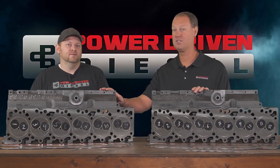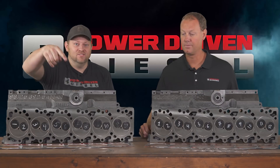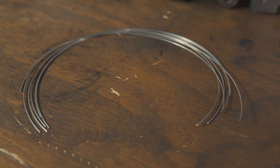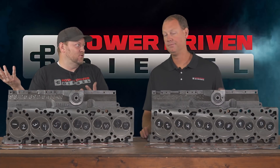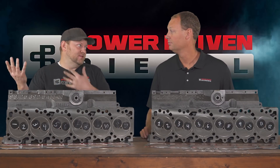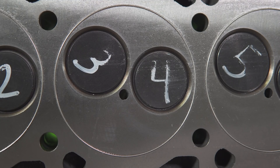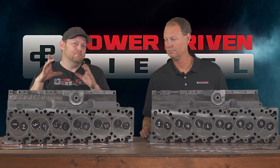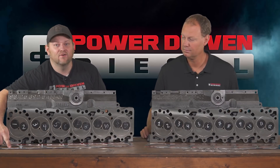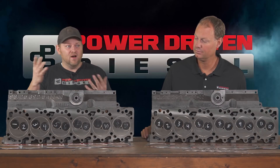First off, what is an o-ring? An o-ring, as you can see right here, is a little piece of stainless steel wire. A groove is cut in the head or the block — generally it's done in the head because it's easier. A groove is cut and a 41-thousandths stainless steel wire is pressed in. That wire is left to stick out about 10 to 15 thousandths, depending on your spec. That little stainless wire pushes down on the metal ring built into the factory head gasket, giving it an extra pinch point to help seal.